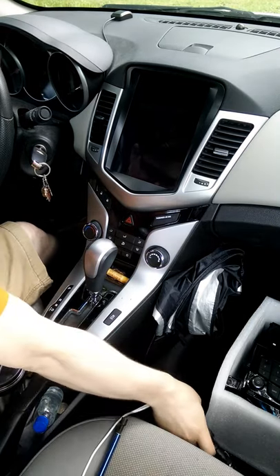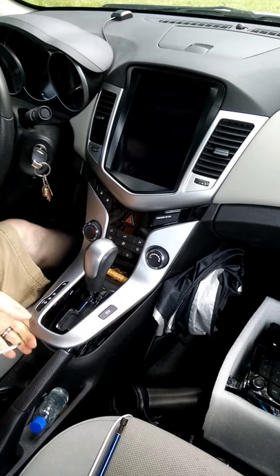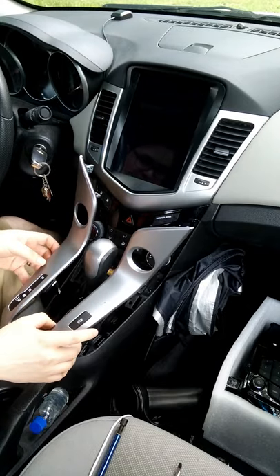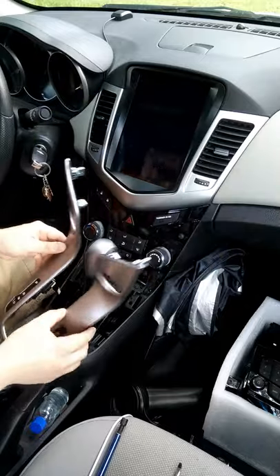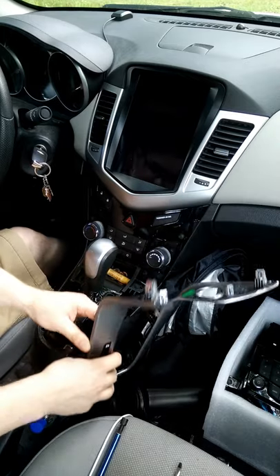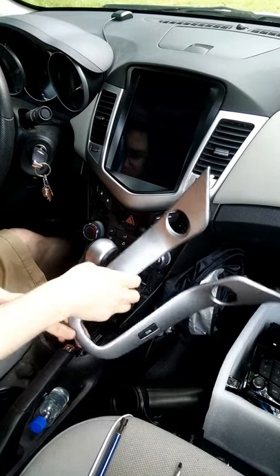I like to start down here by the shifter and stick a flat blade underneath to start prying it up. If you start pulling things up, it'll snap very loudly — just wiggle it and it will pop away. There's a cable attached right here to the traction control toggle switch; you can leave that connected and set this stuff out of the way. There's also a separate connector for the lights that backlight the shifts. Wiggle it away and it'll slide back into a holding position, but pop it off of that and it gives you a little more slack.